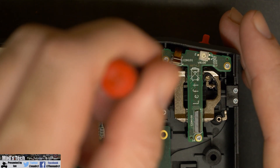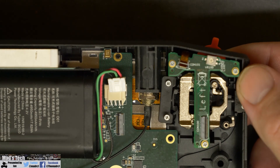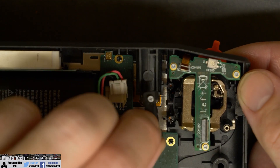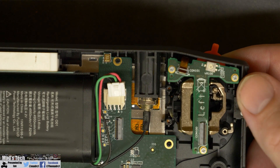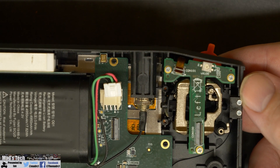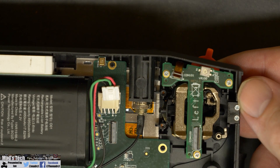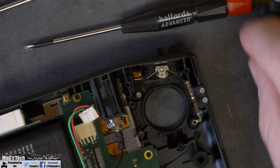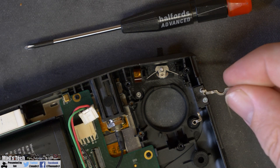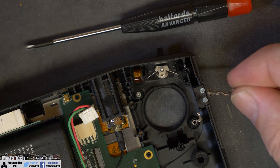So we need to remove this little clamp first. Once the screws are removed you can put a bit of pressure on the gimbal and withdraw the bracket out of the way. Once the gimbal is loose, this leaves enough room to withdraw the spring tensioner mechanism from the right hand side. What you do is unclip the spring, undo the lever from the little clip, take the spring off, and remove it. To show you clearly: you simply unclip the spring off the bracket and then lift the lever up out of the way — place it somewhere safe because this won't need to go back in.